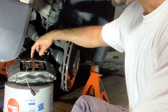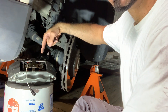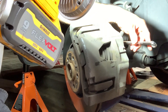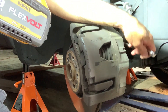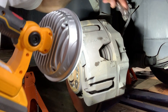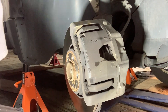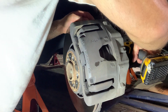The caliper has to be disconnected from the brake line, otherwise you'll wind up the brake line. This allows it to twist. See how when you try to loosen the line it's going to bind? It doesn't have a swivel or universal joint in it. So in order to take it off, I need to loosen the caliper and turn it together with the line. I just loosened the line a little bit — you can see it leaking already.